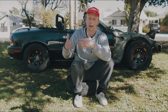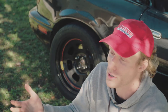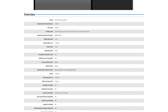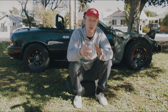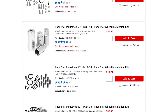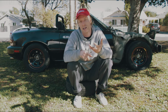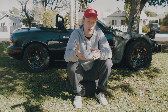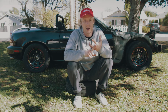We had another situation where we thought we messed up. The center opening of the Bassett wheels does not sit on the hub of the Miata — unlike a hub-centric car where the wheel rests on the hub and the lugs just hold it. We did some research and found that Bassett Racing wheels are lug-centric, which makes sense for a racing wheel. But because we know this car is going to take a beating on track, we want to go the extra mile and have someone machine an adapter piece to make the wheels hub-centric as well. With both hub-centric and lug-centric alignment, the wheels would lock on, never move, and be perfectly safe over any rough spots on track.